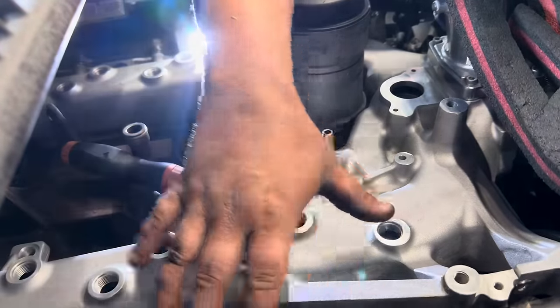The ODAWGS is a tight fit in there, and removing some material off the heads will bring things even a little bit closer. I just want to make you guys aware of this. Please check this out before you tighten this down, and then once it is tightened down, make sure there is plenty of clearance there.